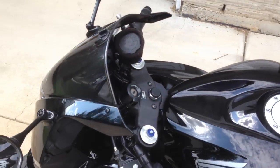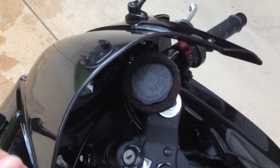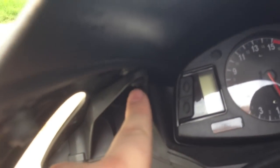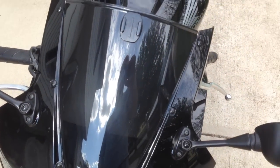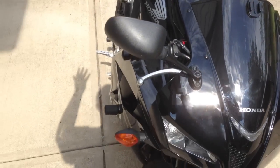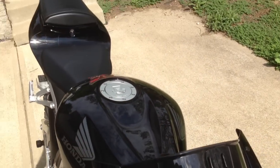It's really simple. I just took the mirrors off, then there are six screws and you can pull these out and the windscreen just comes out. There are rubber grommets on the bottom side and these here that hook into the other part of the fairing — they were a little tricky to get out. But once I got it out it was just a matter of Windexing the windscreen down and hitting it with the plasti-dip. The beauty of it is if you screw it up or you don't like it, you just kind of rub it, it'll tear a little bit, and then you can just peel it off in one big sheet.